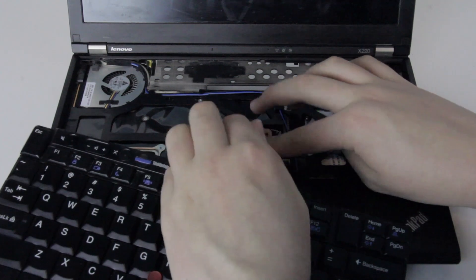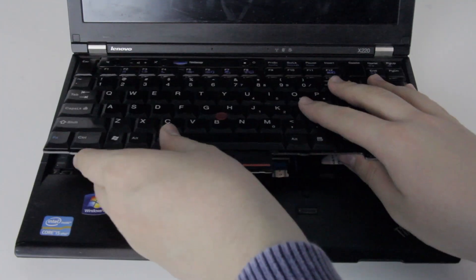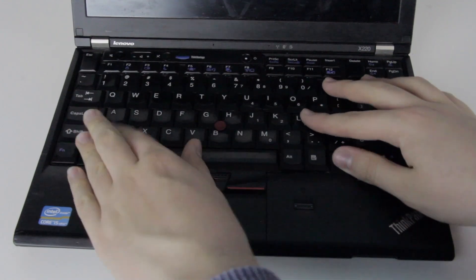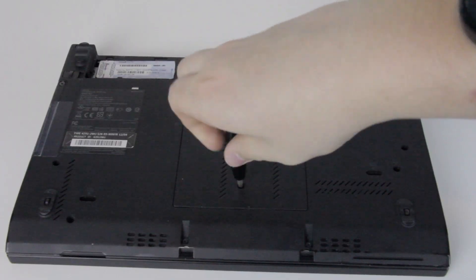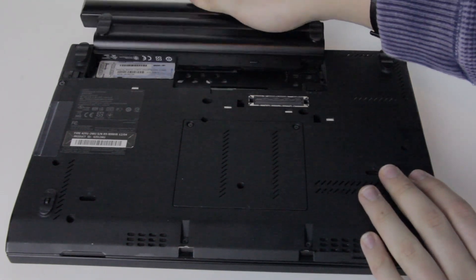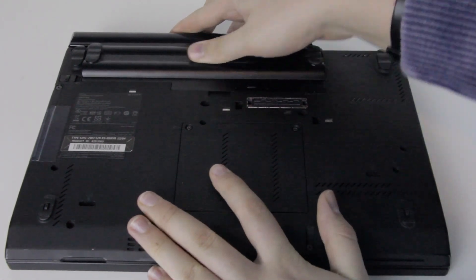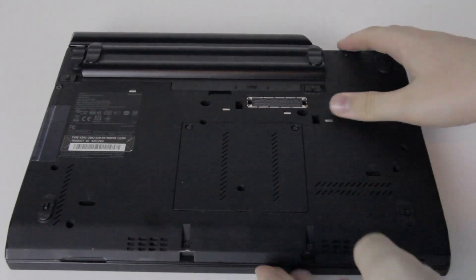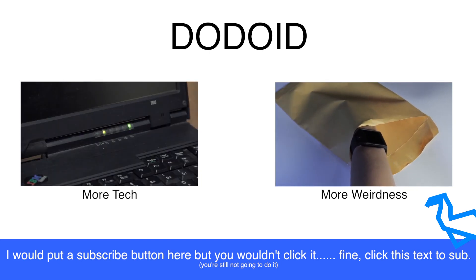Turn the laptop back over and set the keyboard on the palm rest. Push the keyboard connector down into the socket, like you did with the wireless card connector before. Now, lift the keyboard up and push it in at the top. Pivot it down and then pull it towards you to lock it in place at the bottom. Once again, turn the laptop over. Now you can put the two keyboard screws back into the deeper holes. Then line the battery up with its hole and push it forward — the catches will lock automatically. Now just turn the laptop on and make sure everything works.